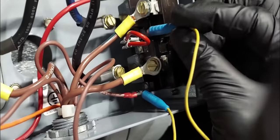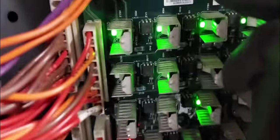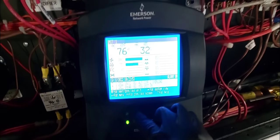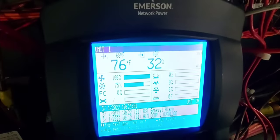These are magnetic test leads. I'll carefully place this in the middle here, and that should take care of the overload alarm. Right away the compressor came on — we have our inputs U25 and U24 satisfied. We can acknowledge the alarm and clear it. We're at 75% capacity now — before we were only getting 50%. With both inputs satisfied we're at 100% capacity.